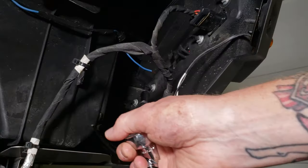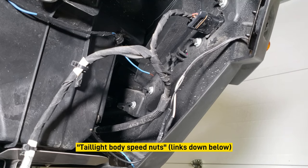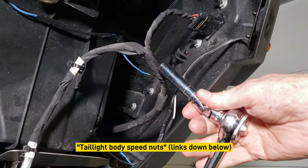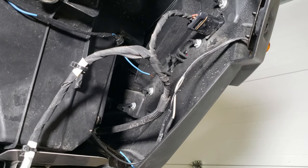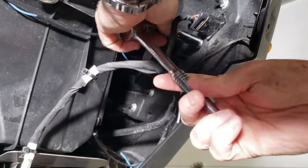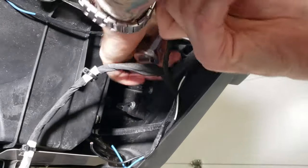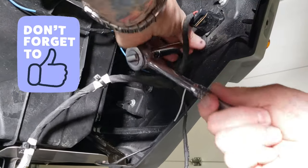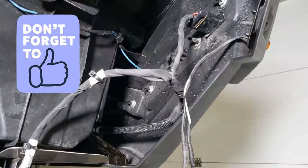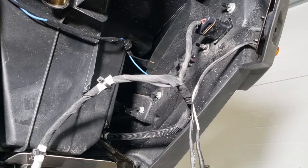As you can see, these are the three little thumb nuts. They go on the plastic nubs. Use a deep socket for that 11 millimeter — and 7/16ths also works. I'm just going to get this one out and show you how easy it is to pull it out. It's very easy. There you go, guys — that's about it. I'm going to go ahead and do the other two and I'll meet you over at the table.